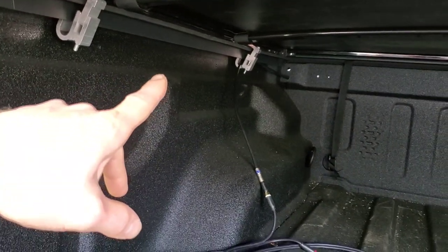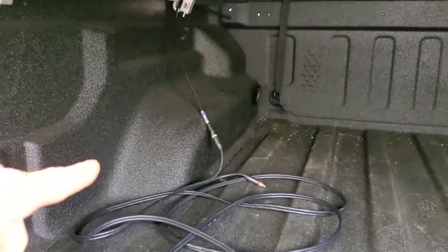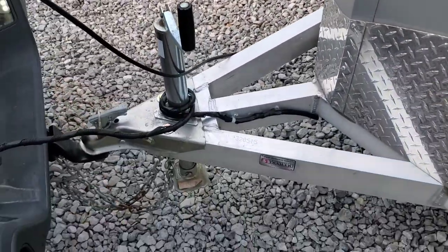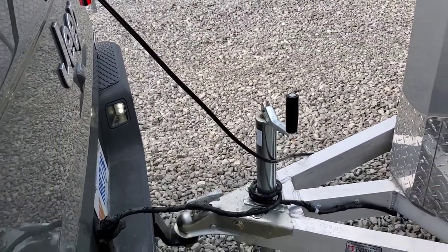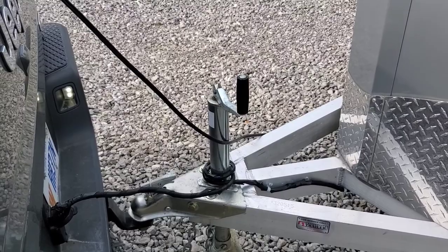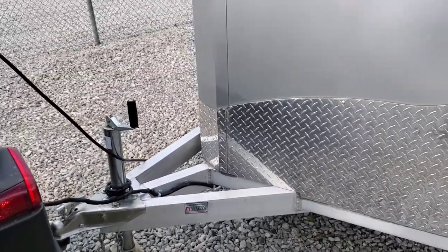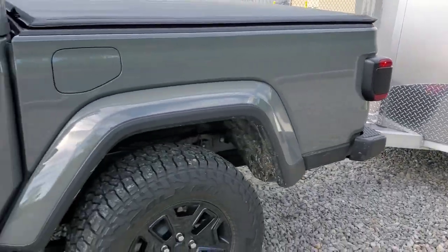Inside the bed of the Jeep I opened up a hole just a little ways and poked it through. That's where I'll keep the cable most of the time — I'll zip tie it up to the side and it sits there when I'm not using anything. For my trailer I just run a separate AV cable connected to the trailer. I'd suggest putting in a waterproof connector so it doesn't corrode, as that's gonna affect your video quality. And that's it — you're all set with a pretty badass backup camera.